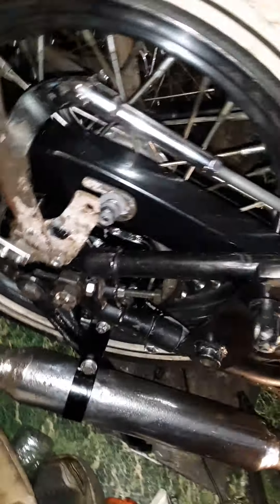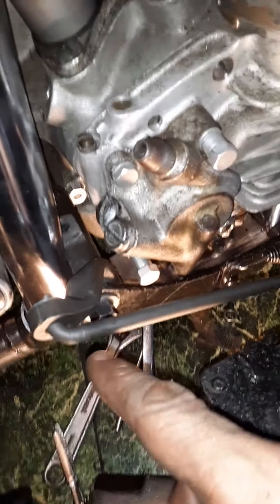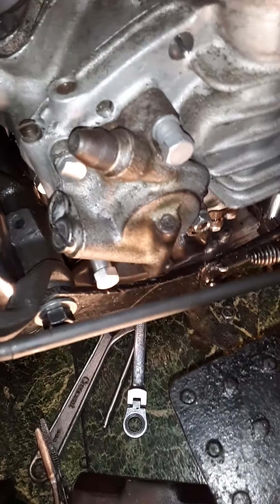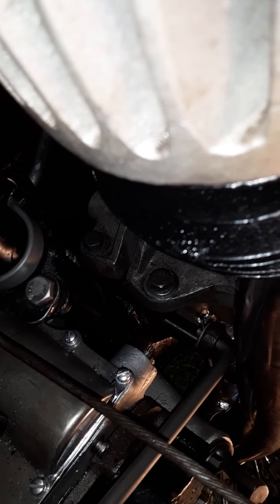What we have here is the Harley-Davidson rear drum brake foot-actuated brake system. It's using this crossover right here, which did require a different foot rod than would have been on the stock bike. This is an aftermarket one but an OEM crossover, and they don't give you much room with the squish pipe. You don't really want that pipe moving. It is very secure — I don't think I'm ever going to have to slam on the brake.